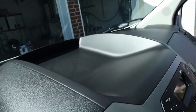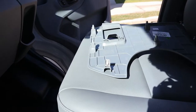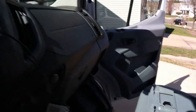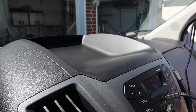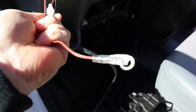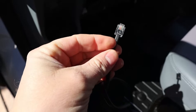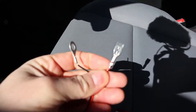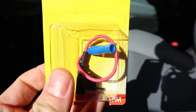Then I'll figure out how to get from this fuse panel through the access panel and come out the top. I think I'm going to have to take this part of the van apart — I hate these connectors. If they've got the same kind of connectors as the panel I just took off, I thoroughly hate these, but I've got plastic tools. Now, this is the actual wire I have to run for the radar detector — it's standard terminals on one end with a fuse in it. The radar detector is a Bel 9500; it's powered from an RJ11 connector so it only has two leads. I'll find a screw to ground one out, snip the blade connector off the hot side, insert it into the add-a-fuse, crimp it, and that should be good.